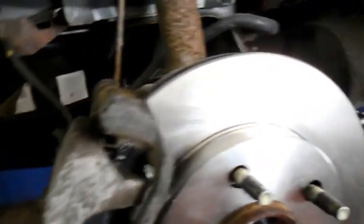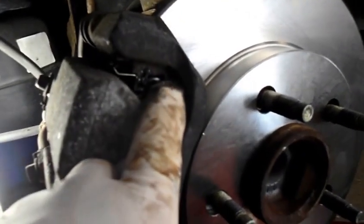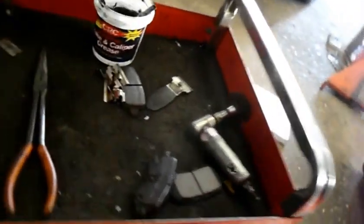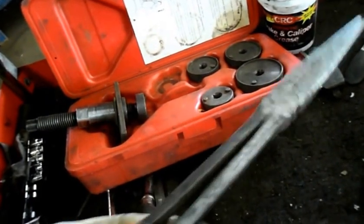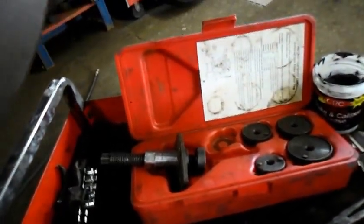So now I'm just going to recap exactly what I did. Rotor's on. We cleaned up the hub right here. We put the mounting bracket back on where it was previously removed from. We tightened up the bolts here as well as down underneath, and the bolts that hold the caliper to the mounting bracket. We replaced the hardware inside here and lubricated everywhere that the brake pad touches. Now remember, you can use needle nose pliers to rotate the piston back in, or you can use the tool that's actually made for it. When I do the other side, I'm going to show you how this tool works versus using the pliers.